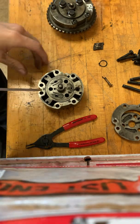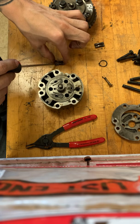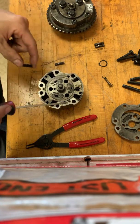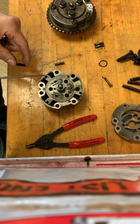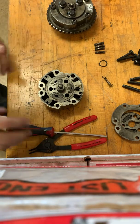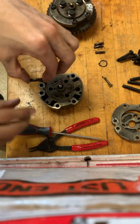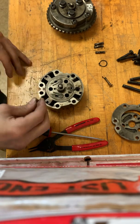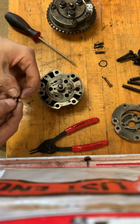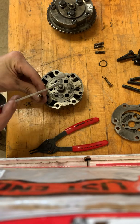There are a couple of things to note before you take this out. These little pieces right here are what hold tension on the inner phaser gear to the outer phaser. You have one right here, right here, right here, here, here, and here. The reason there aren't any in some spots is because I already took out four of these. What I want you guys to note is the orientation — you'll have three of them where the metal will be facing inward, which will be your outer ones. The inner metal piece will be facing towards the phaser gear.